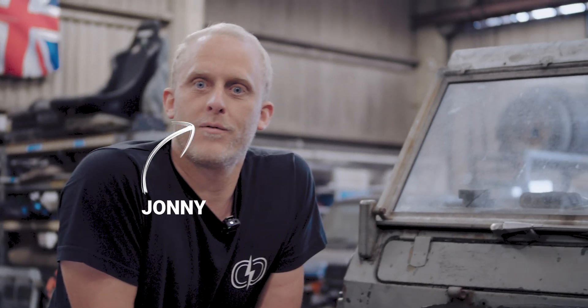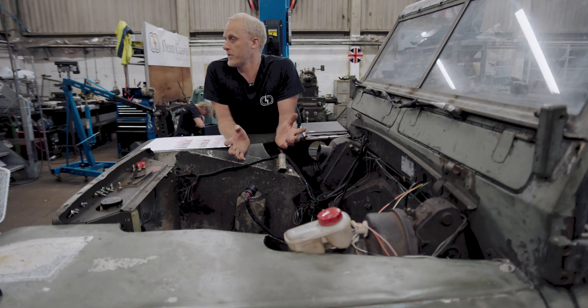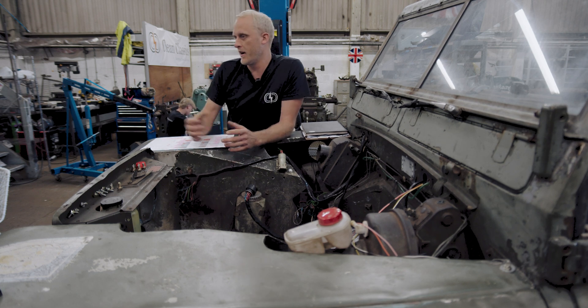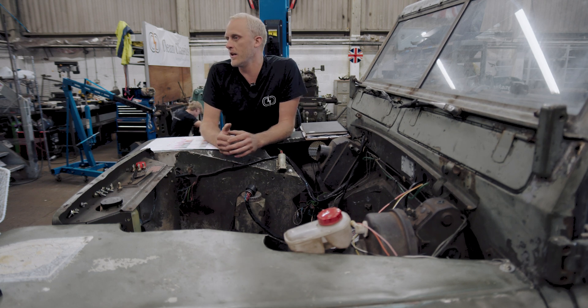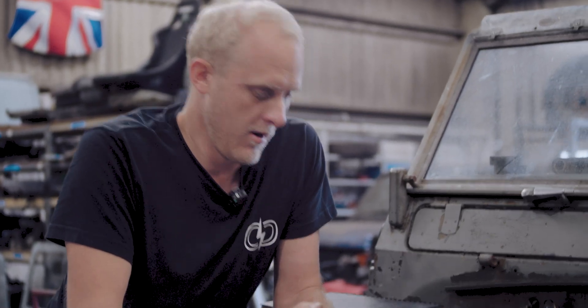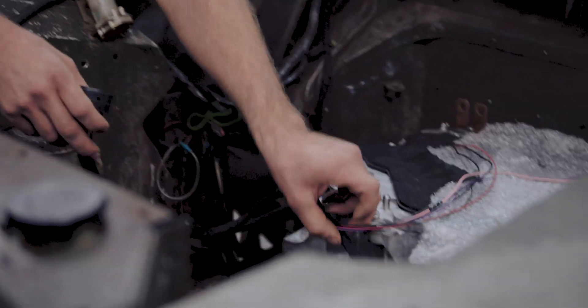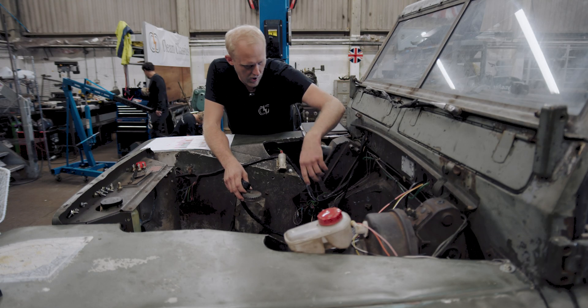Back in the left-hand drive Dutch car for Suns 4x4, we've been building all the wiring looms this week and running them into the vehicle. It's a bit different because it's a left-hand drive car so the instruments are on the other side, so we've got to run wires a bit further. I've been making a note of cable lengths so that we can replicate it if we have to build another left-hand drive loom. The comms looms are all in — the motor and inverters connected and everything for our system is run.